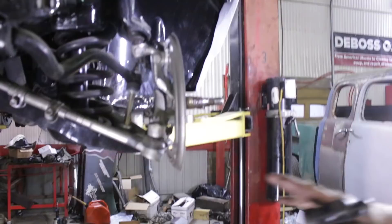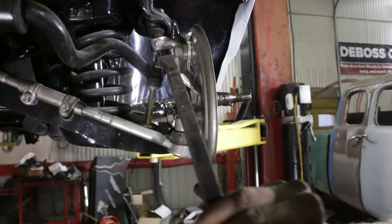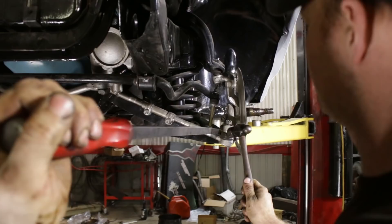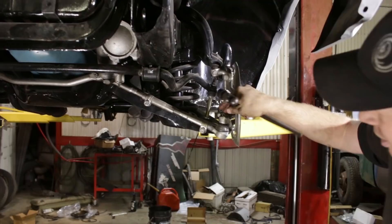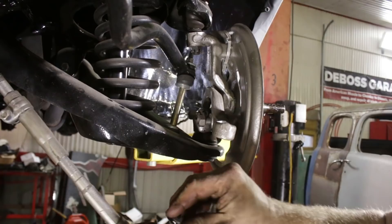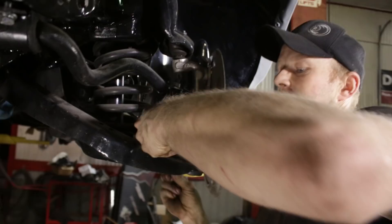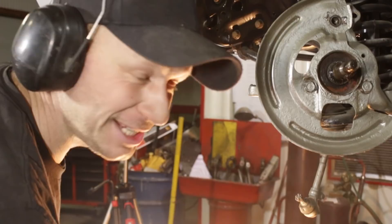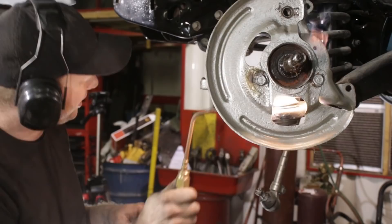You can use a pickle fork and wreck your boot if you want to take your tie rod end off. But if you can take a bar — and it works better with a buddy — just put a little bit of tension on it and then tap it lightly. It should pop right out. Keeping the nut on top makes it so that it doesn't go flying. That works from a small guy like this all the way to transport trucks. The struggle is real — this is what the other car shows don't show you.